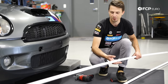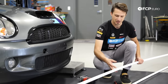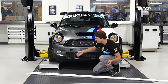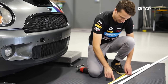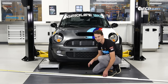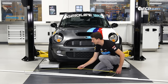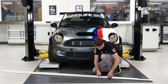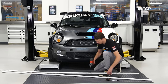This PVC measurement doesn't need to be perfectly exact because we're not going to hang anything off the ends of these pipes. I'm going to mark both pipes and cut them—you can use a hacksaw, a wood saw, or a reciprocating saw; anything will really cut this stuff. Using my reciprocating saw, I'll do a quick cut through.